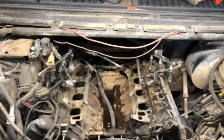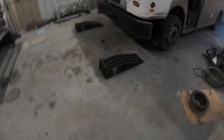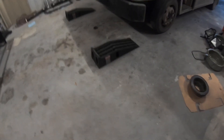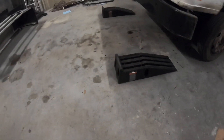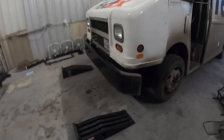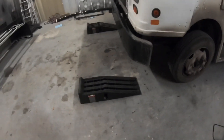I'm just covering all the basics. If you're fat like me and you can't fit underneath these trucks, you need ramps. You can get these at Northern Tool — they're relatively inexpensive. Make sure they're rated for at least 6,000 pounds. When doing this job you also need wheel chocks. First thing you want to do: roll the truck up onto the ramps and chock the wheels.